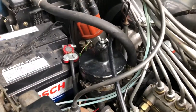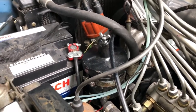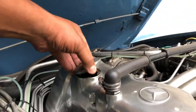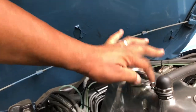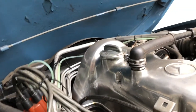The power steering fluid is pretty low, so when I get underneath I'll check for active fluid leaks — it's near the bottom, and I've got a photo of that. Moving on — I've got the engine numbers there. Taking off the crankcase cover — I'm not feeling any blow-by or seeing any smoke coming out. The gasket may need to be replaced, because I'm seeing some splatter marks and a little bit of runoff. Hoses are in decent shape. There's a little bit of a top-end noise, but nothing too significant — we'll see how it does once it warms up.